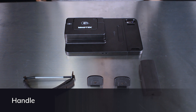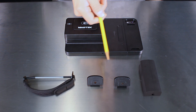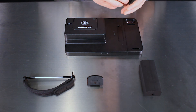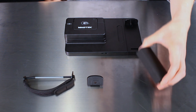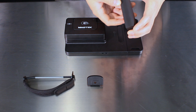The handle has the following parts: the rubber handle, two end caps, and the strap with a threaded connecting rod. The two end caps are identical with a lip that slots into the grooves on the back of the case. Place the rubber handle on the back of the case ensuring that the concave side of the rubber is facing towards the card reader.